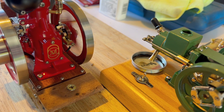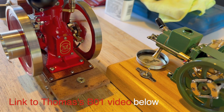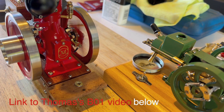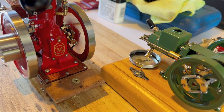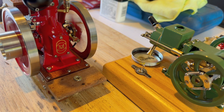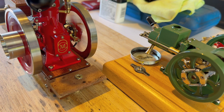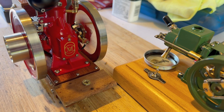I took advice from Thomas, the PC Guru — he's mad about these engines over in Christchurch, New Zealand, and we're up in Shetland, so we couldn't get much further away. He recommended putting a little bit of grease inside the crankcase onto the big end, so I put some spray grease on that, and I also put some grease on the governor mechanism just to keep it sweet.